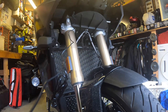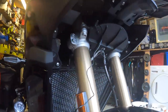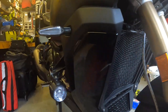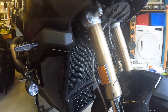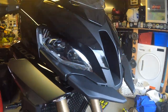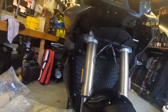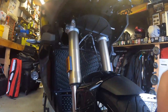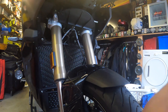So I've refitted all the screws — a little bit fiddly but not horrendous. I was able to get them all in and lined up in the correct order. You have to be careful that you put the right sized screw back in. I loosely did them all first so they're all aligned, then I'll go round and do them individually. There are no torque settings, so I'll just do them relatively tight but not enough to damage the plastic, because at the end of the day it is plastic going onto plastic.